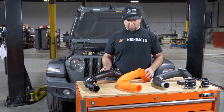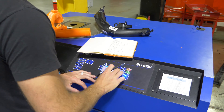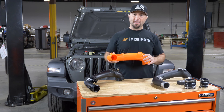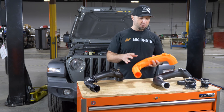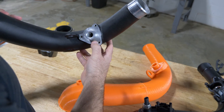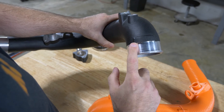That's what we did. First we 3D printed it, did all the test fits, ran some flow bench numbers — it way outflows the factory unit. There are a couple other advantages too. You get a positive seal when you bolt the blow-off valve back on, and there's no deflection in this plastic thing here. Being cast aluminum, it's a real heavy-duty piece. We also provided this area here for you to drill and tap for gauges or water-meth.